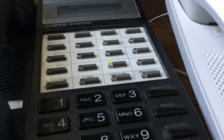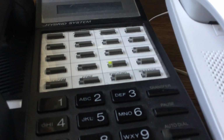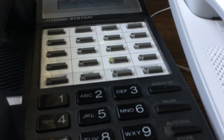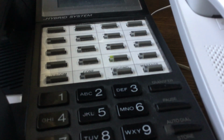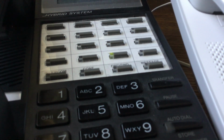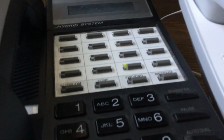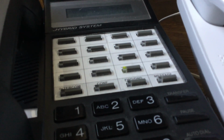And keep in mind, I'm just looping back and forth between my Google Voice number and a CNET inbound from the PSTN. And those are the same numbers that I'm using. Obviously, I just have numbers programmed on these buttons. So clearly those numbers have multiple trunks. The nice thing is the Google Voice number that I have, apparently that has multiple trunks. If you go to hangouts.google.com, you can make multiple phone calls at the same time.